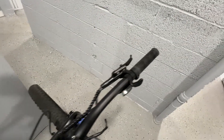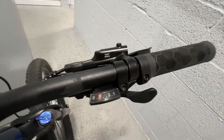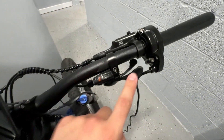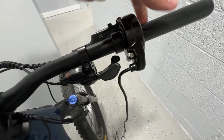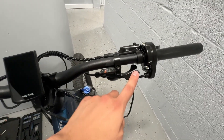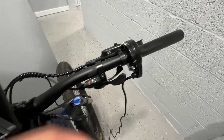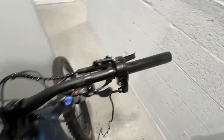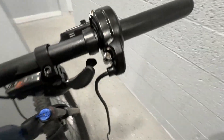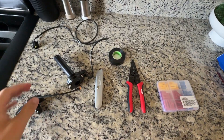Take off the grip and make sure the twist throttle fits on the handlebars — it's going to be another allen key. The gear shift did actually get in the way, so what I did is just slid it down. It's not super important to me since the bike pretty much propels itself with just quick changes. Tighten it down — it fits super nice. So I think it's time to get chopping.